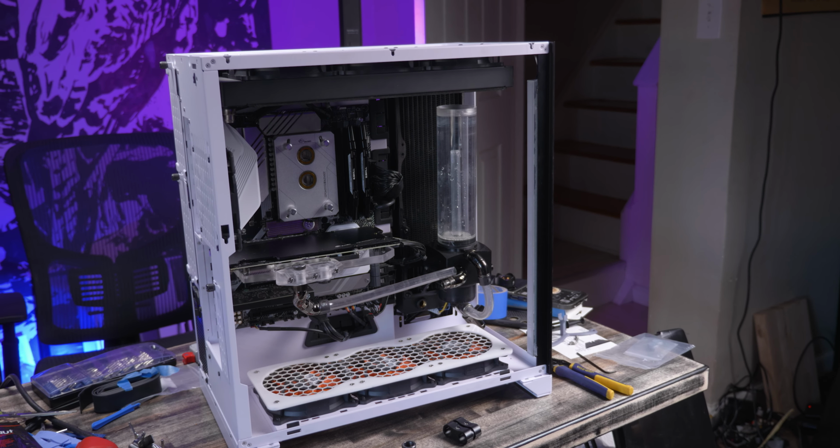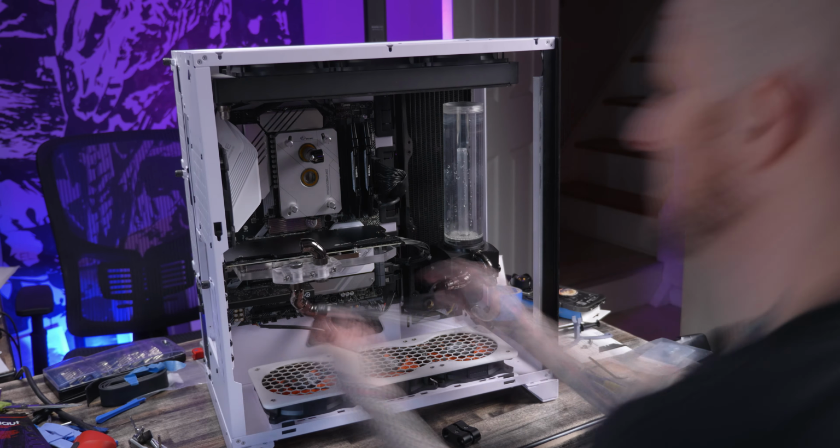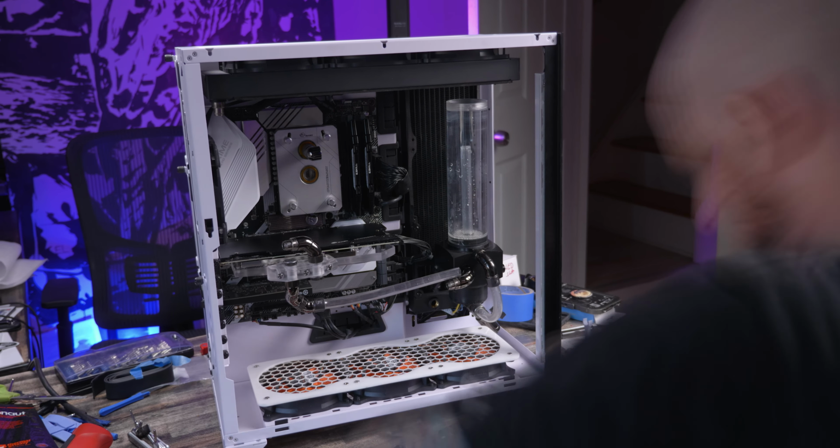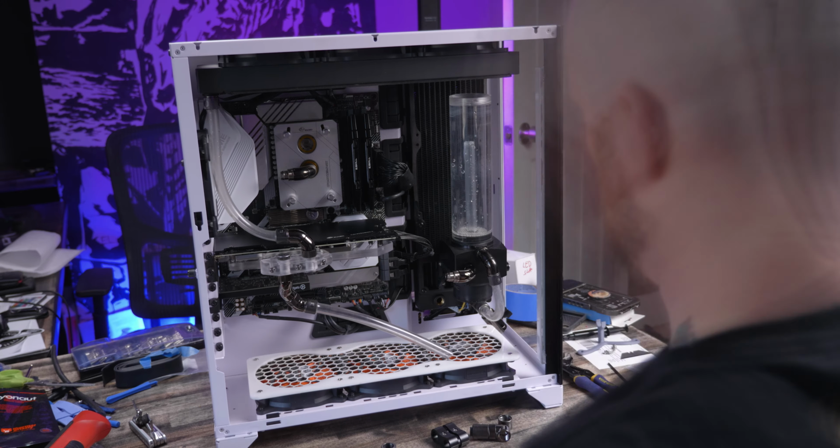into my water loop. Now the system that I'm running here has two 360 radiators that were previously only cooling the CPU while I had the 3080 air-cooled, so I'm not too worried about adding additional radiators or changing things in that regard. I think I've got the cooling capacity for this. We will do temperature testing and all of that in this video yet.